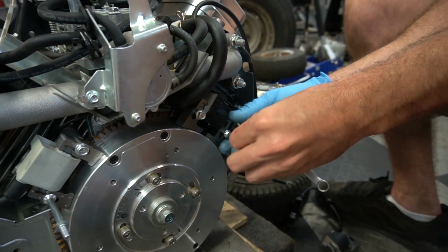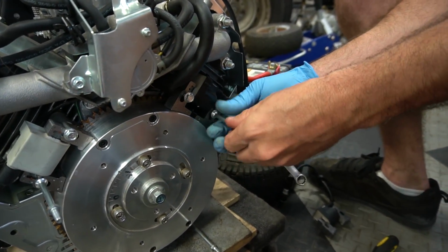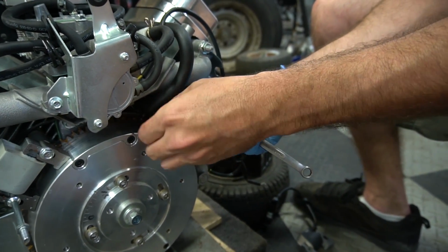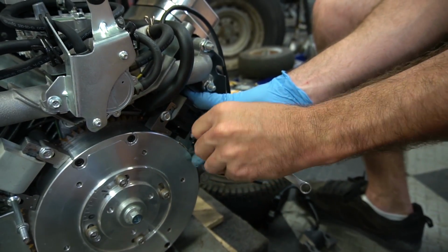This has been our problem with this engine. Sometimes it has spark and sometimes it just doesn't. I don't know what it is. It's the weather or something. It's a mystery. Could our coil gap just be? No, you said you gapped it exactly what it was before. I'm gonna do the same thing with this one, and it's gonna have spark, which means that the coils are bad. Our brand new coils are bad.